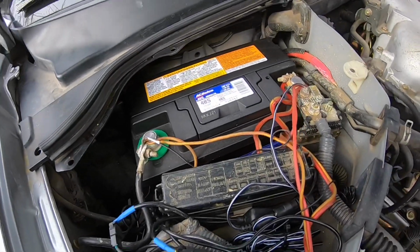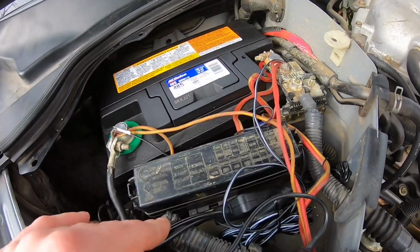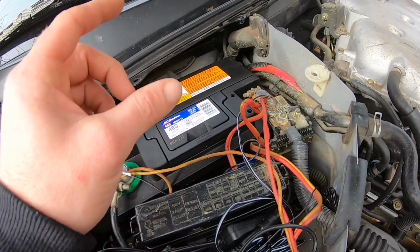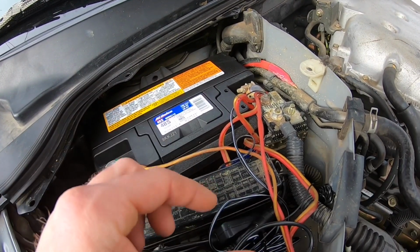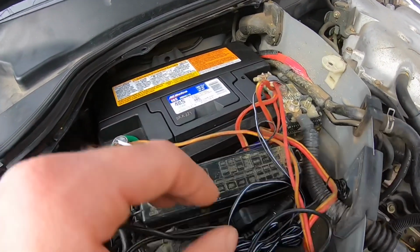So yesterday I went out and got a brand new battery. This thing is a mess in here right now. So basically what we're gonna do is I'm gonna clean up all these wires right now and get them right. Change out these terminals, first of all, and then I'm gonna run the wires all the way into the car with the toggle switch. I'm gonna have to cut out a piece on my center console to fit the switch in there to make it look like it blends away. But basically it'll turn the power off and on, controlling it, because right now literally it's still on.